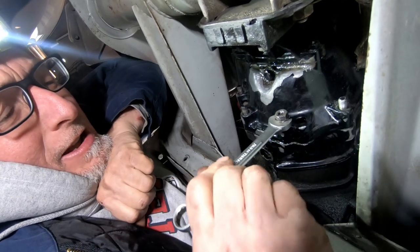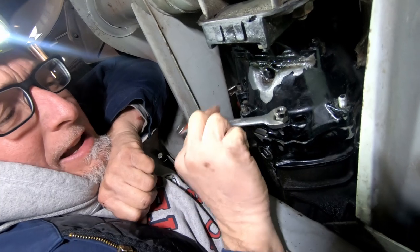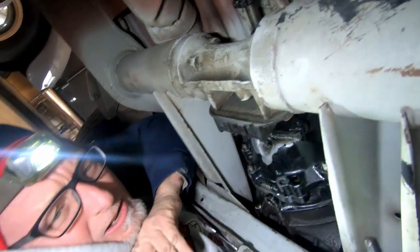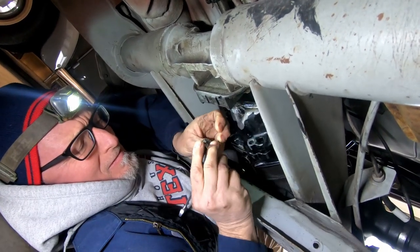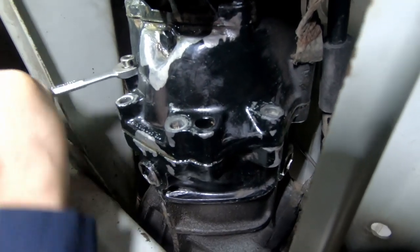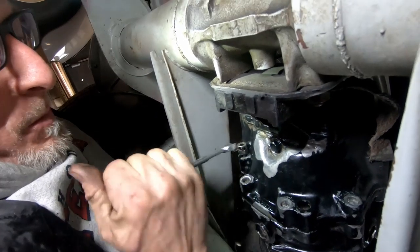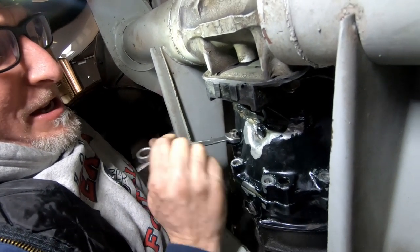Matt Jackson refers to double nutting. Get them really snug and then it'll basically act like the head of a bolt and you just back out the stud, because we're going to replace these studs with longer bolts for this purpose. Here's the stud. We have to take four of those out. Then we'll be putting on the bracket. On this step, if it's in the bus, just take your time — get those two nuts together really, really tight. This double-nut process to get the studs out is the hardest part of this. If you know you're going to put a transmission in a bus, just take these out before you put your transmission in — it's easier than doing it on your back.